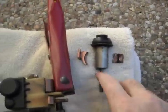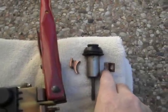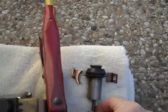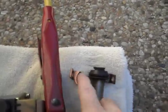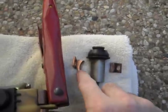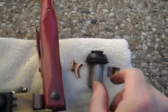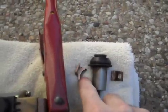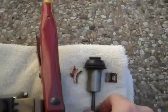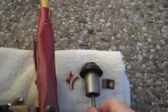If you can see here, these are the two contacts — the one that goes from the battery side, and over here, this one goes to the motor. This is the plunger that contacts these two to transfer the 12 volts across and the hundreds of amps of current. If you see these grooves in them, over time the plunger can't go down far enough as these grooves get worn in. So these contacts have to be replaced. I also replaced the plunger because it is all pitted and a bit worn and torn.